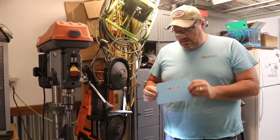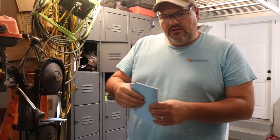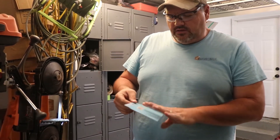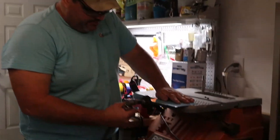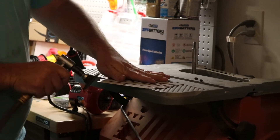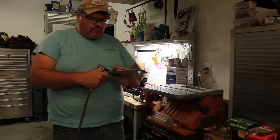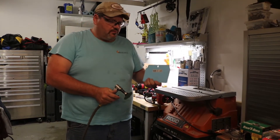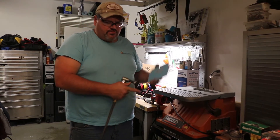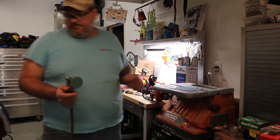We got this cut out — it was a no parking sign, not that anybody's probably worried about that. We'll go ahead and sand this down a little bit and get it cleaned up. We have pretty smooth edges. One of the reasons we have this offset is I only have about seven and a quarter inches. There are some welds in the corner but I want to make sure I have a sturdy spot for my plate. We'll go ahead and get a couple of holes drilled here and then we'll get her mounted.